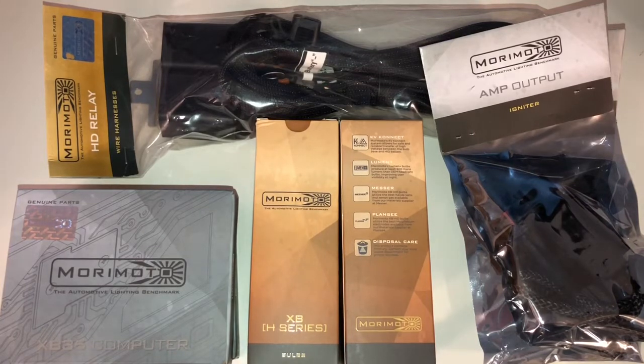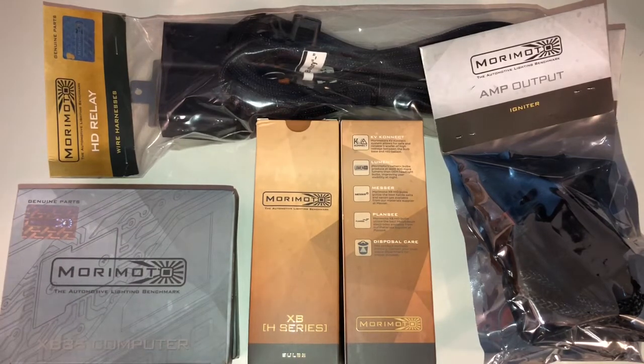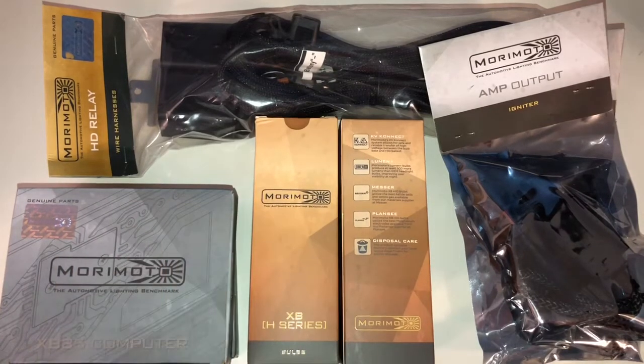This is going into a 2018 RAV4, and these are the best HIDs you're gonna get right now as far as the aftermarket goes. So your optimum thing to do would be to do a retrofit where you actually take real HID projectors and put them into the housings of your current headlights in your car. And then what you wanna do is get D2S bulbs and the same setup like this. That's the proper way to do it. That's how it's done from the factory.